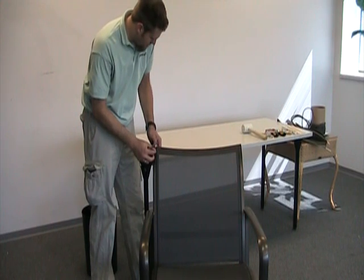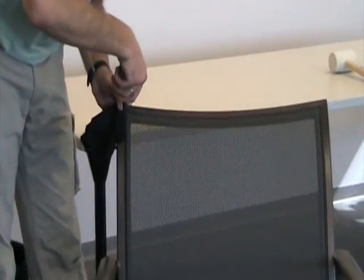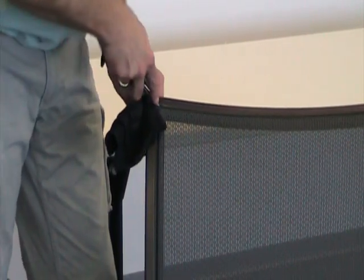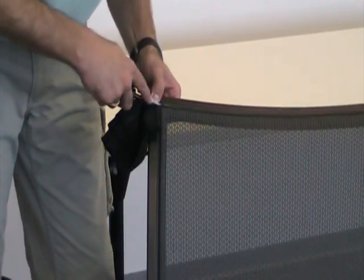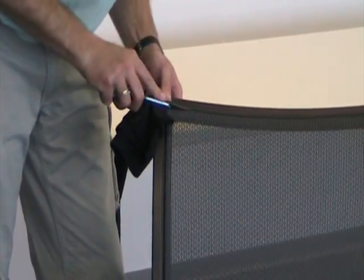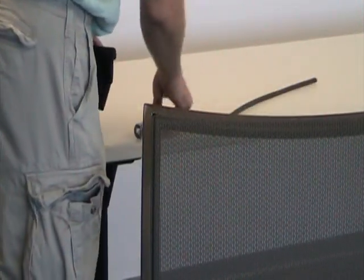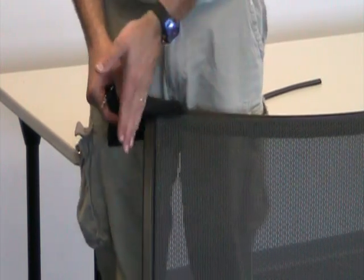Take your piece of fabric on the edge of the finish, take your flat blade screwdriver, and very carefully and slowly rock it back and forth to get underneath that retainer. Start prying it up while keeping solid tension on the screwdriver and the rag so it does not rub against that finish. Once you get to a certain point, use your hand to easily pull that retainer out. Once the top is out, start working on the sides using the same process — going from the top instead of the sides.